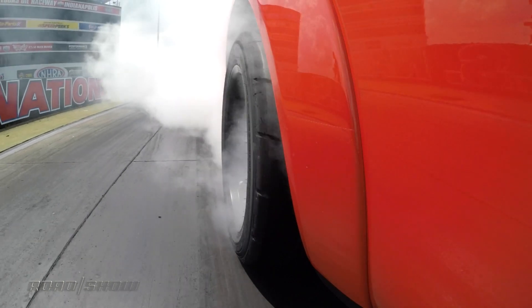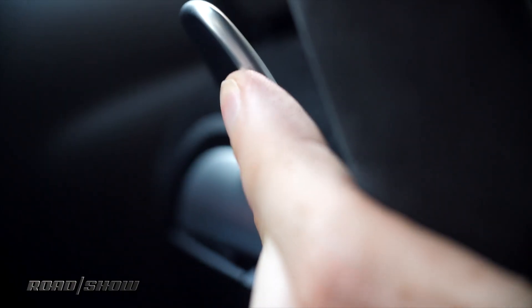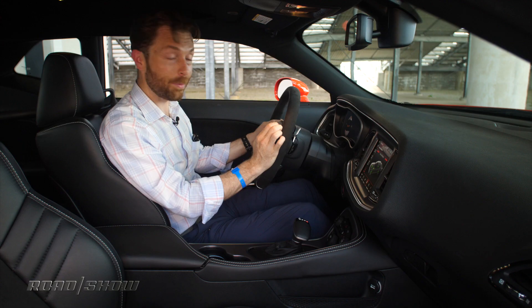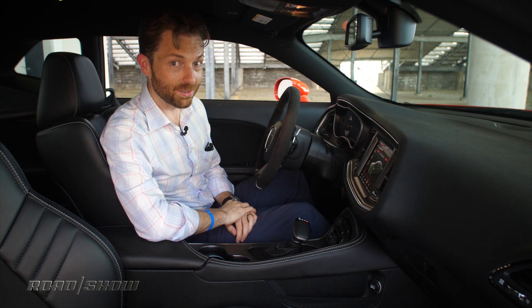You come off the OK button, the car will roll forward. Then it's time to enable the trans brake. A foot on the brake, both paddles to enable that, come up to the engine RPM you want with your right foot, come off the right paddle, come off the brake, then you release the left paddle, and then all hell breaks loose.